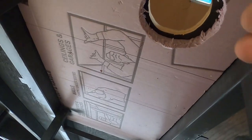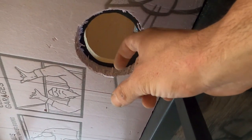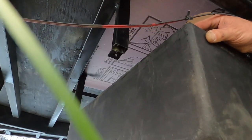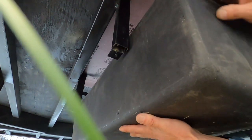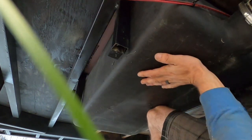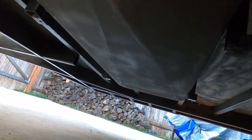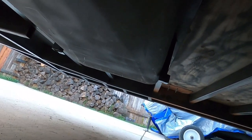Black water tank — got the grommets installed, brackets are made. I put one-inch foam insulation to space it out down a little bit so the toilet grommet fits, because it's kind of long. Just wanted to have extra space. It's a drain hole. This is how it fits — pretty snug — and I'm gonna attach support bars across.